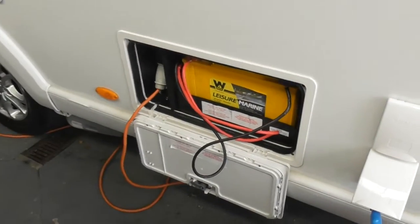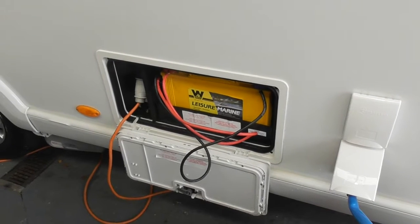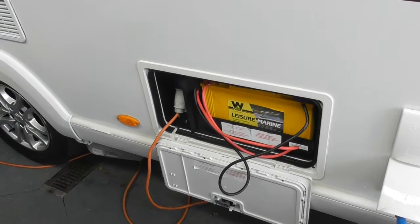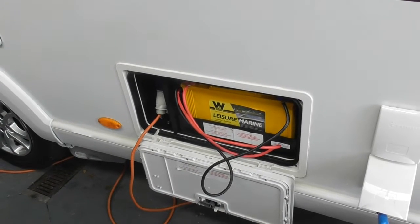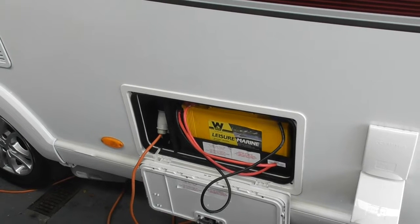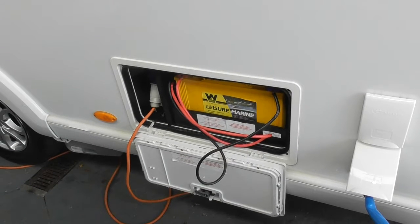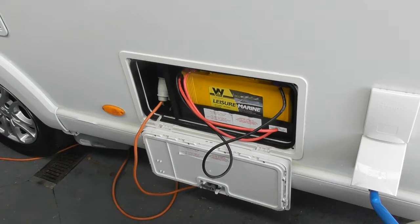Obviously you've got your battery fitting. Have a look to see if it charges okay overnight — it may have been that something was left on in your old van, that's why it drained down that week. If you manage to move the van with the motor mover, that's usually a good test to see how good the battery is. It wasn't just one move — there was a lot of moving — so it must be keeping a certain amount of power in it. There's a little gauge in there to show you what the power is. As long as the 240V is not connected, you'll see the actual reading of the battery. I tried to check the motor mover by unplugging the electric and it just moved a tiny fraction — that was lack of power. But it's working okay because the 240 is in — whether it's going to charge it or not.